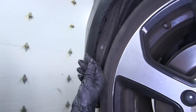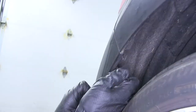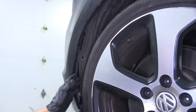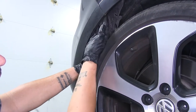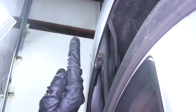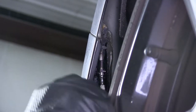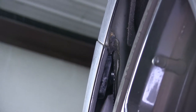We'll pull the other two out as well. Once we have those screws pulled out, we're going to grab our wheel well liner and pull it away from the car. If we look up, right where our fender is going to meet the fascia, going up into the body, we're going to have another T25 Torx bolt holding everything together. With all these removed, we're going to do the same thing on the other side.